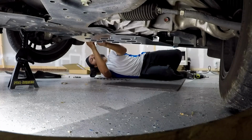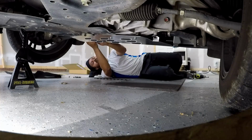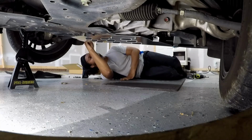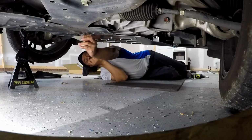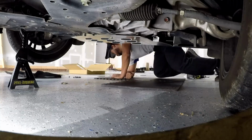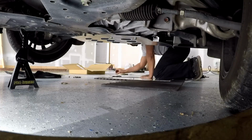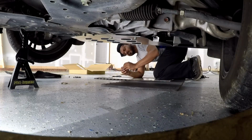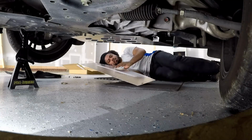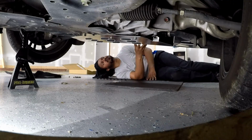I mean, the normal plastic undershroud that comes with the car, it has the vents for the front mount oil cooler, but they're kind of small and don't perfectly line up with it. But it is venting it. But now you got oversized vents on it for venting the front mount oil cooler. And then the normal vents in the back are the way they vented it and curved it towards the back. It lets the air out, but also lets air go up under the car.